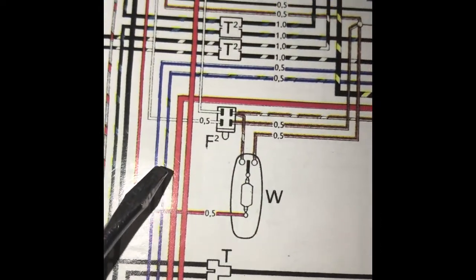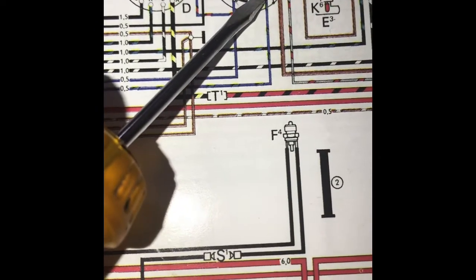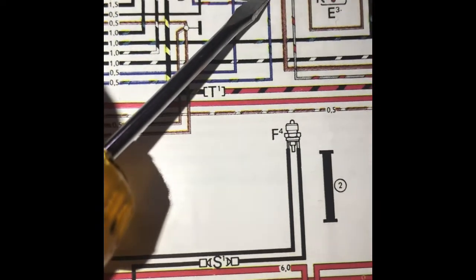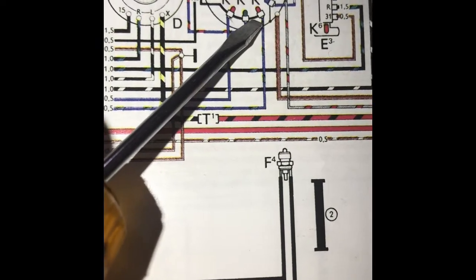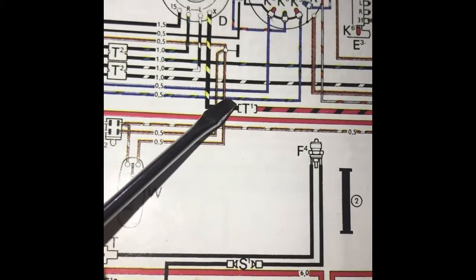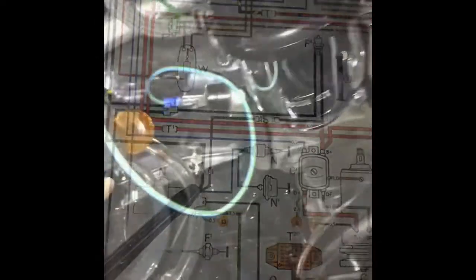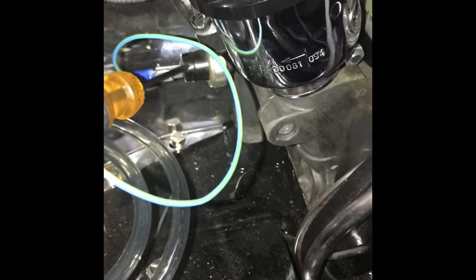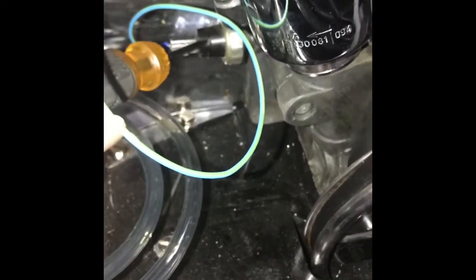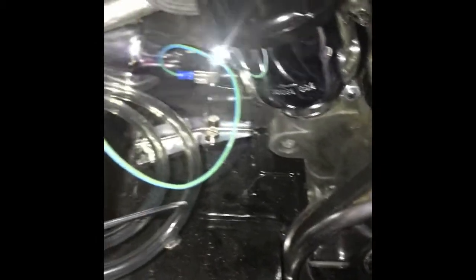Notice that it will continue to go up and then it connects into your K3 terminal, which happens to be your oil pressure warning light. Let me show you in the speedo where that's connecting — it is actually labeled as such. Here in the rear of the car where the engine is, this is the blue wire with green stripe that I mentioned earlier. And again, that's going to go inside the harness and through the side panel.